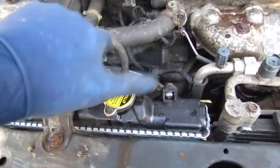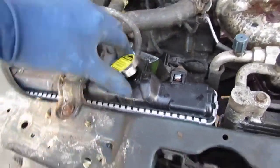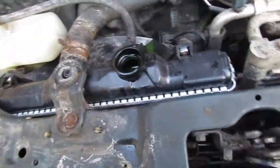Drain the coolant. Do that. Take the cap off, so the air pressure releases. Right here, that is a valve. We just turn that on the radiator, at the bottom of the radiator. I'll try to do that without getting my stuff too wet. I reached my hand underneath the engine guard and turn left. Get my drain pan here. Hopefully I won't miss. Okay, that's good.